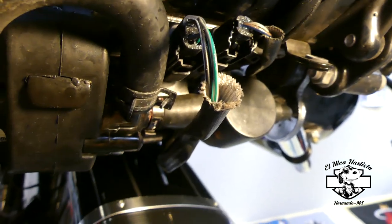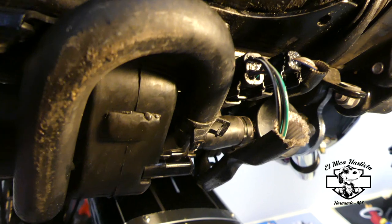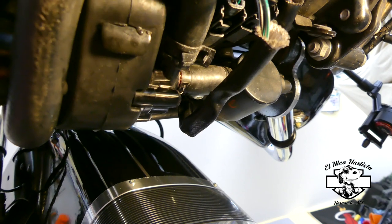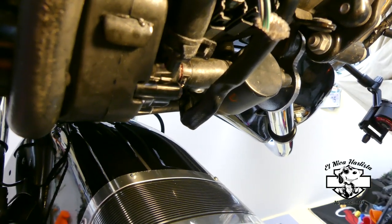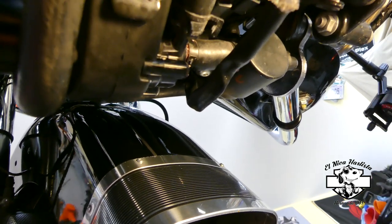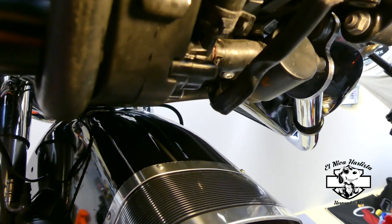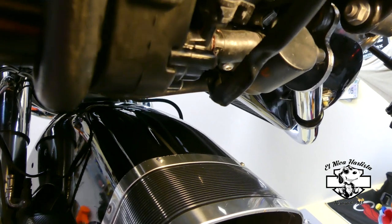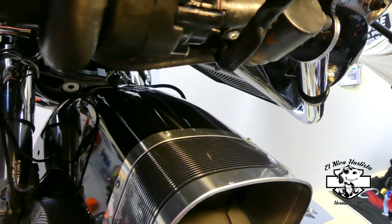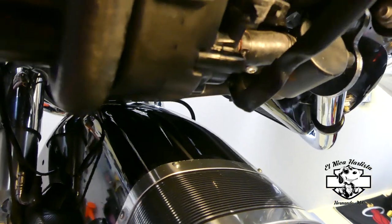One way that I made it a lot easier for me to check resistance on the sensor, I went through here because it goes to my sensor. It's a lot easier because trying to get meter leads to hook up to your sensor pins is very tight, especially when your sensor is still hooked up to your left radiator. So it's very easy access through here. You disconnect here and the harness goes straight to your sensor. And I use this point to measure the resistance.